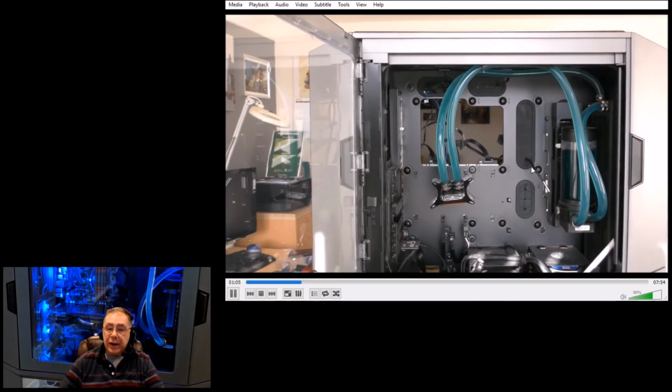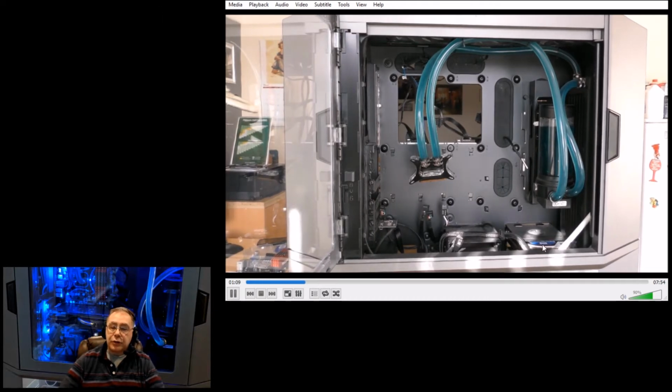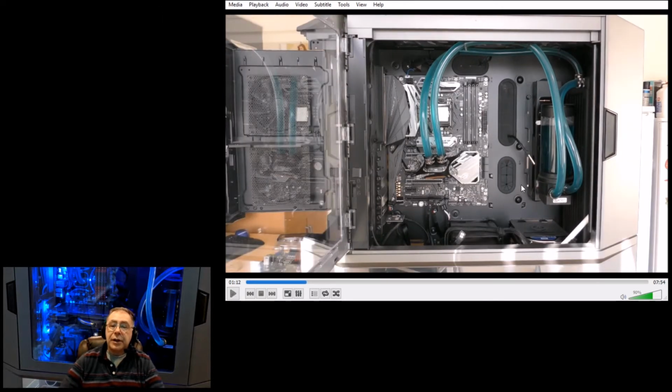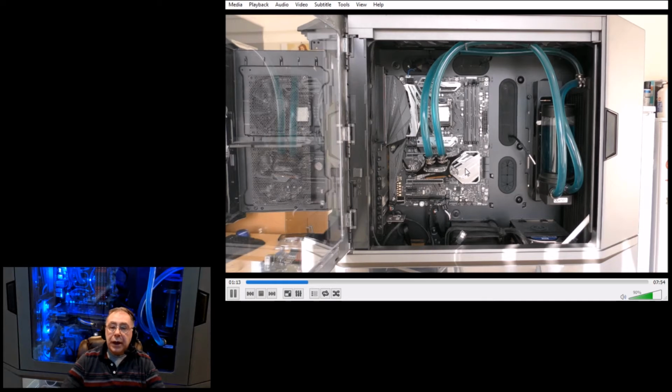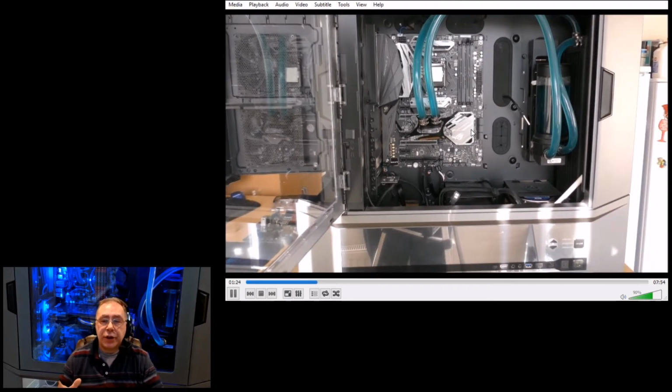I'm just showing you around it at the moment. There's one of my hard drives. That's a 3 terabyte hard drive sitting in there. The rest all sitting behind. So with that, there you go. That's my new motherboard on. So like I say, 3 screws up there, 3 screws there, 1, 2, and a blank in the middle now. And then there's a processor there. So then I've got to put that onto there with thermal paste. There's several ways. There's all different ways you can put thermal paste on.